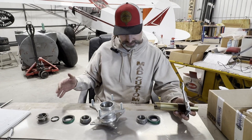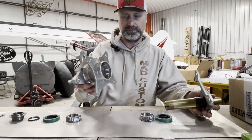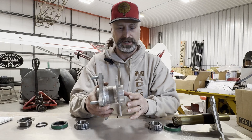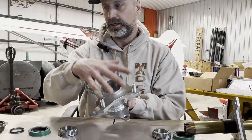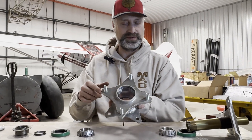I'm going to show you an easy way to demonstrate. Here's the setup. Here's the hub — this part of the hub is where you mount your disc. Everything's made up for a Polaris Razor, and here's where the bolt pattern is. You bolt up your ATV or UTV rim. The bolt pattern is 4-bolt by 156mm.